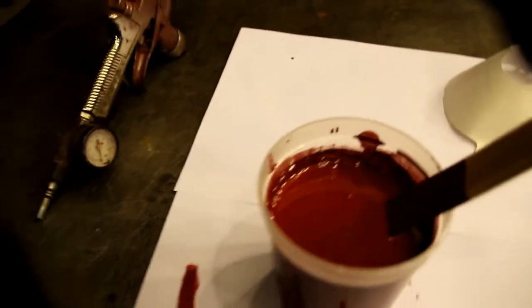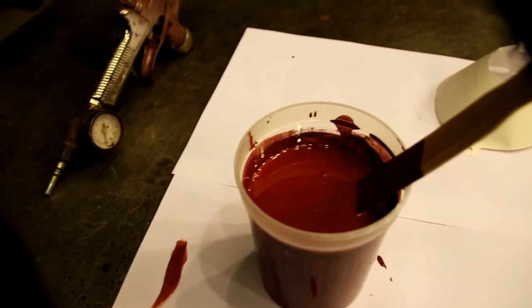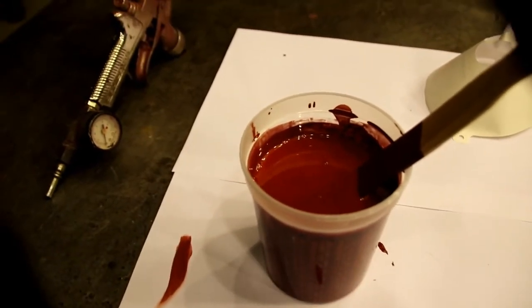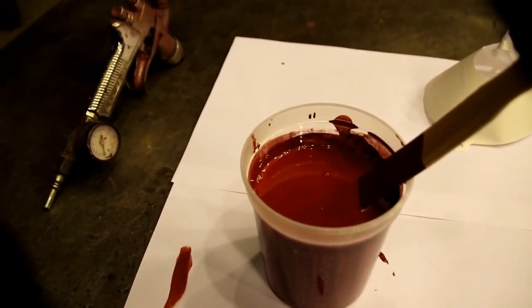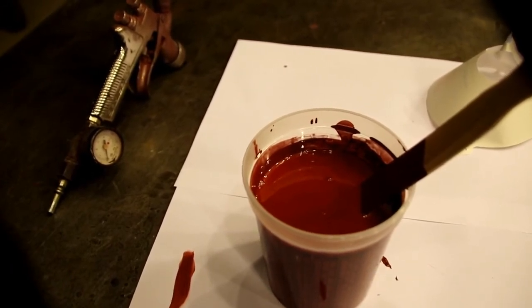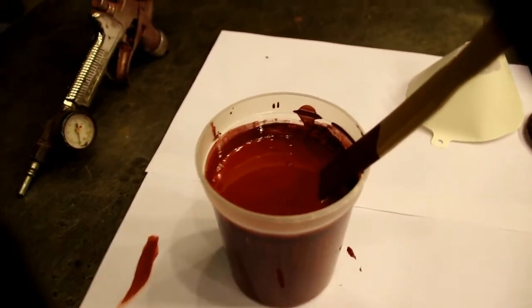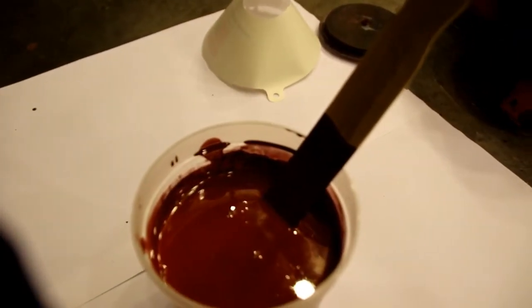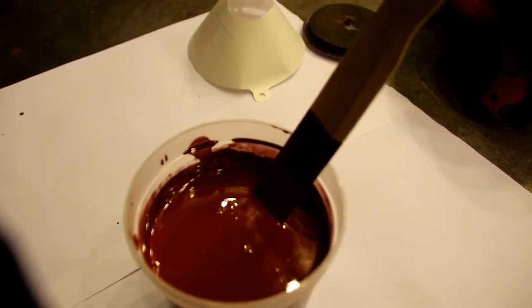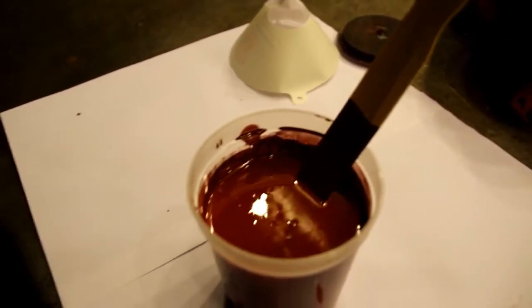When you're doing your wheels, I try to keep the least amount of paint on the wheels that I can. You don't want a thick wad of paint where you tighten your lug nuts — you'll just start cracking your paint and it'll start peeling off. The minimum you can get by with on wheels is better. Prep the metal before you start doing anything, and the least amount of primers and building primers will be better off for you.